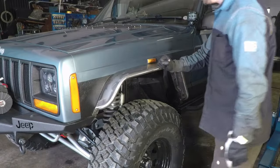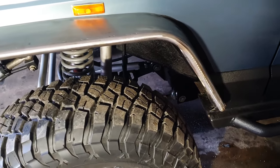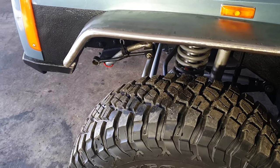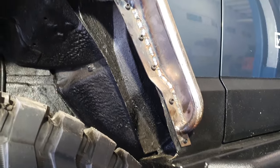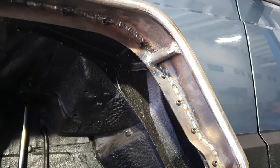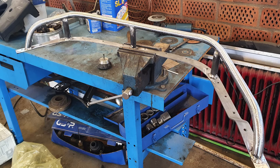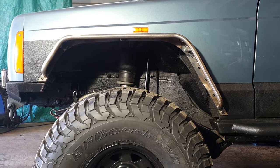This is the tube steel fender here, the first one I made yesterday and it came out nicely. I used 25mm outer diameter tube with a 3mm wall and this is 2mm sheet steel on top. We've got three pillars just to help support the whole thing together, and it's welded to a 3mm template. The hard part will be making another one almost exactly the same.